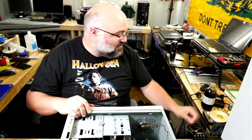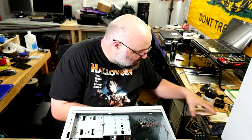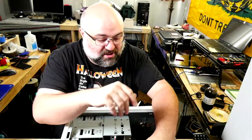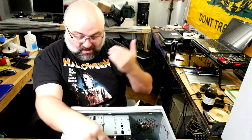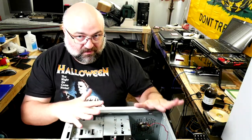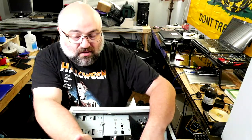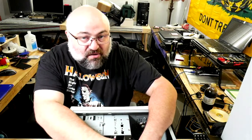You know what? I'm going to tell you what my solution is. In fact, is it over here? It may not be, but nope, I think I threw it away. My solution is I have my own Linux distribution. I don't really distribute it much, but I have my own little Linux-based system where I can boot a machine even this old from a CD. As long as it's got like 128 megs of RAM, it'll boot without me even having to cough. I can boot it from a CD, run Linux, and just stick in a USB Ethernet adapter or anything that a modern Linux kernel will support.